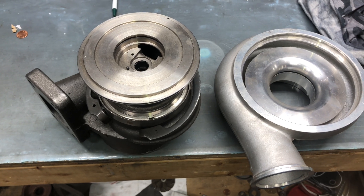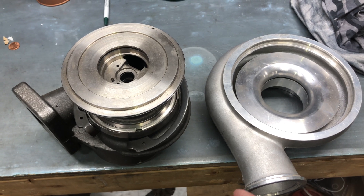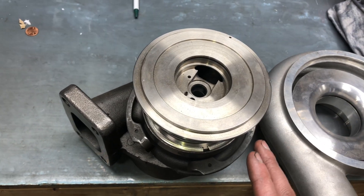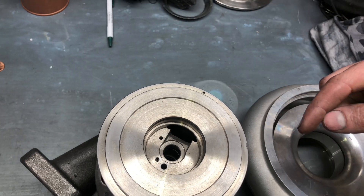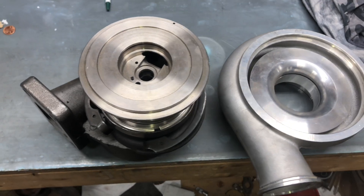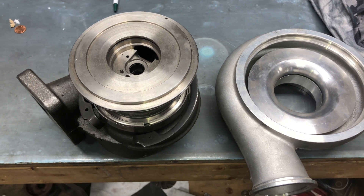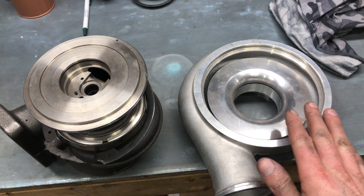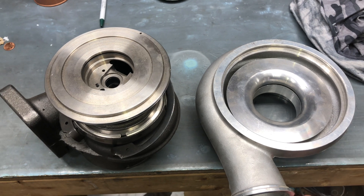I'm not really sure why people think it's possible or a good idea to do this, when it is possible to do the CW turbo without using this compressor housing on a second gen — but you have to rotate the compressor housing and also make a special bracket so the wastegate actuator still mounts. That's a lot of extra work some people probably aren't willing to do, but it is possible. If you go the other way by making that adapter plate, it may not be possible, but that would be my best guess of how to do it.